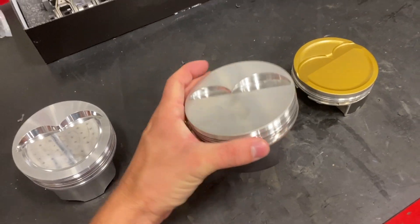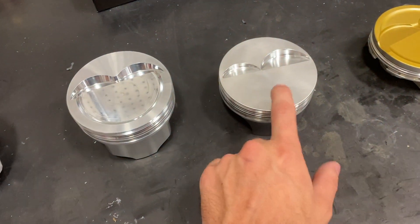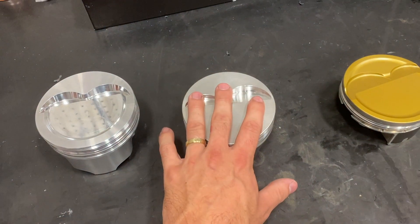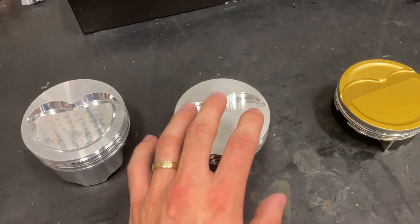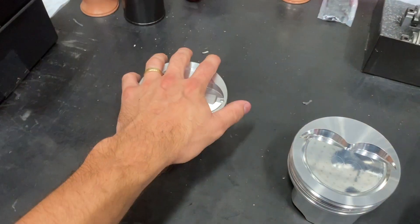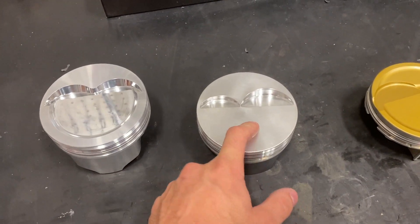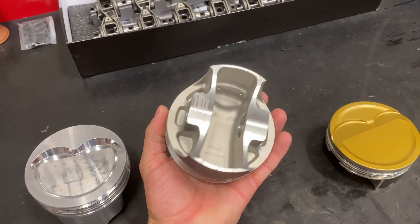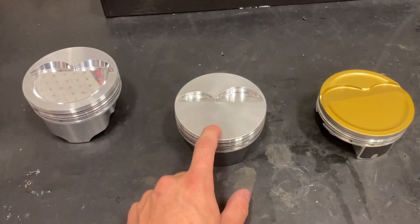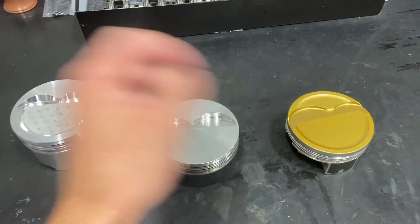Whenever you exceed the rating of the 4032, that's when we go to the 2618 forged aluminum piston — and right now I'm just talking about the pure metal composition. This is a forged piston that has almost no silicon in it, so it actually has a lot of thermal expansion. The pro is it has no silicon, making it extremely durable and incredibly hard to crack — it's more malleable than any of the others. If you whacked the hypereutectic with a hammer it would shatter; the 4032 might have hairline cracks; but slam the 2618 with a hammer and there won't be a single crack. It's so malleable and soft, which is good for extremely high performance power adder drag race engines — we want it to dent and take abuse rather than shatter and tear up other components.